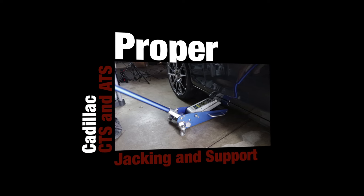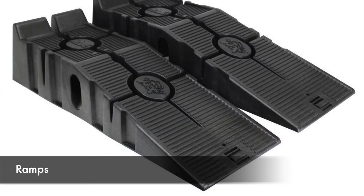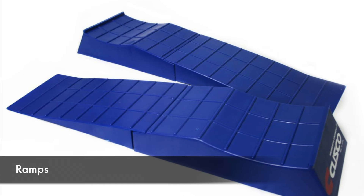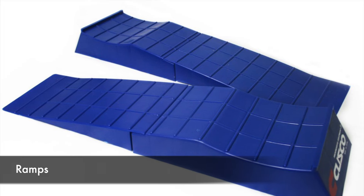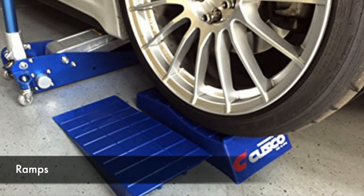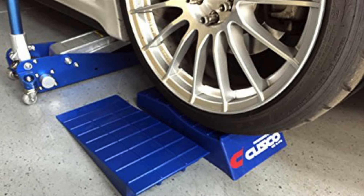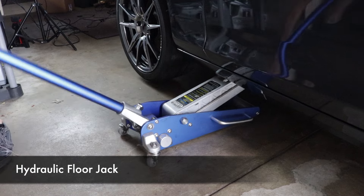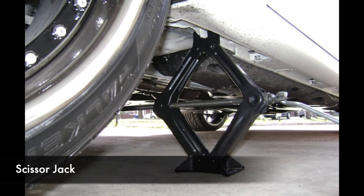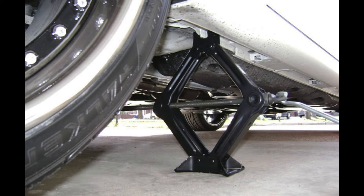Alright, let's get to the process of raising this car to work on it. The easiest way to get your car off the ground is simply drive up on some ramps. These type of ramps are really cool because you can drive up onto them and then remove the sloped portion so that you can get your jack under the designated jacking point of the car. But most people just use a simple hydraulic floor jack. In your trunk you may have a scissor jack, but they're really inefficient and not that stable, so I don't advise using them.